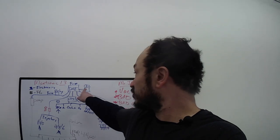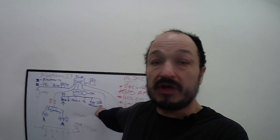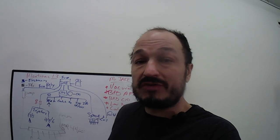This process of diagnosis that I'm explaining is for a no start, but it does crank, meaning that your battery is working, you turn the key, the car goes rah, rah, rah, rah, but it doesn't start and run. So it's a no start, but it is a crank. Crank, no start, okay? So first thing you need to do is make sure the computer is on, the DME is on. There's two ways to check that out. It is to see if the check engine light's on. And secondly, the idle control valve, which I'll show you here, the idle control valve should hum, okay?